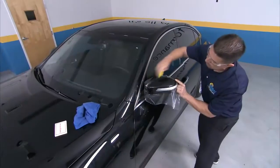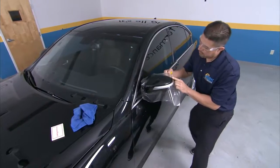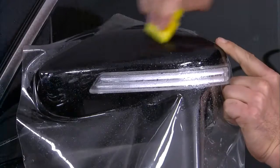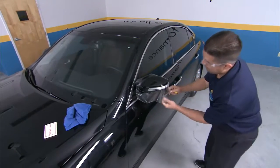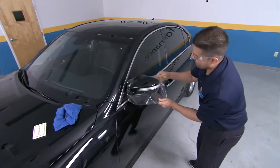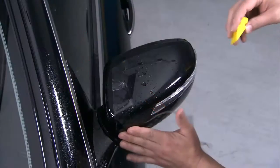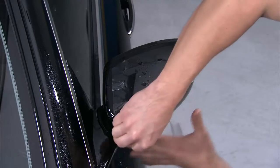It is important to note that with ClearShield Pro's enhanced durable and more pliable look and feel, it's tempting to try to overstretch the material to achieve a quick fit on parts like mirrors, especially for bulk installations. Do not overstretch the material. Paint protection film will eventually return to a more natural state and can leave visible seams if you overstretch it.